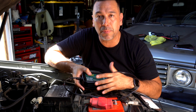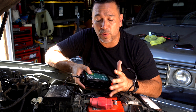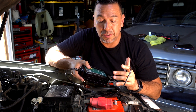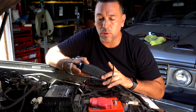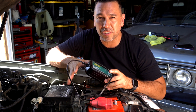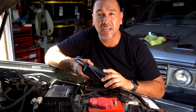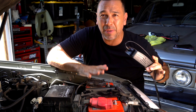When I talked to Odyssey, they said they need something with more amps to fully charge their battery — a minimum of 10 amps to get it to where it should be. So 4.5 amps is not going to be significant enough to maintain and power this battery and make it live longer than four years. I picked this up at Costco for 40 bucks — it's still good for flooded batteries — but for AGM-specific batteries you want the correct charger.